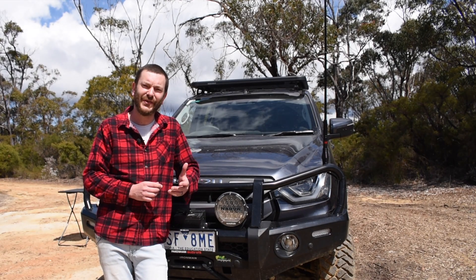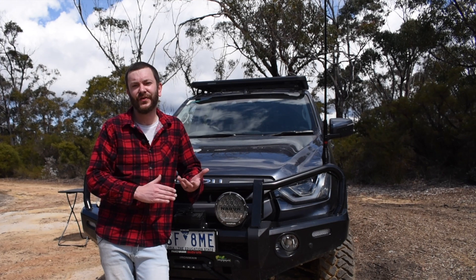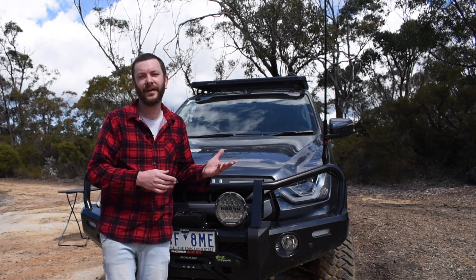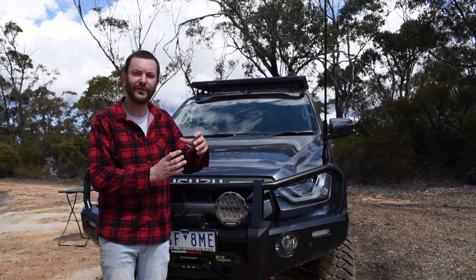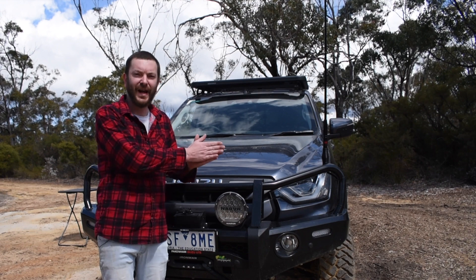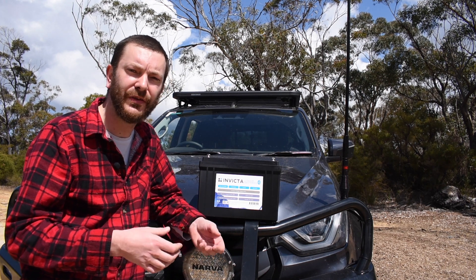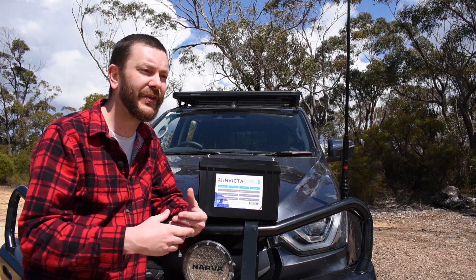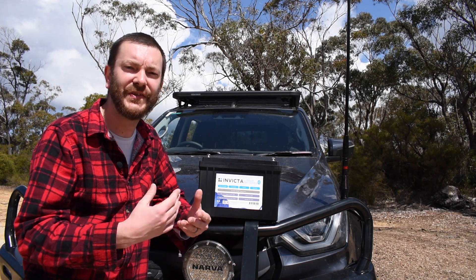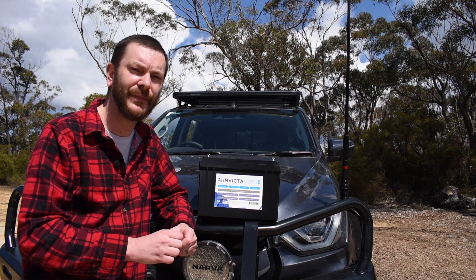So why do you need a dual battery system? Quite simply, if you were to plug accessories into the vehicle's start battery when you're stopped, there's a chance you could drain that battery to a critical voltage where the vehicle won't be able to start. So by having a secondary battery, you can run all your accessories off that, and with the DC-DC charger from Piranha, it'll cut signal or voltage, so you won't be able to drain your start battery — you can drain your auxiliary battery. I personally wouldn't bother with an AGM or a lead acid second battery these days, because lithium technology has come so far — lightweight, the ability to discharge the battery more, et cetera. So if you're setting up a vehicle from scratch, I think you'd be kind of mad to not go lithium, which is exactly what we've done.